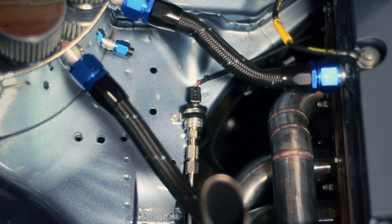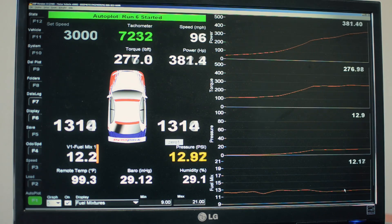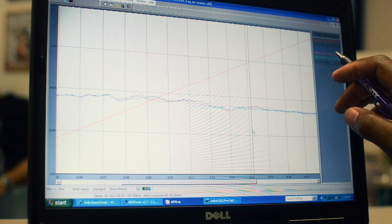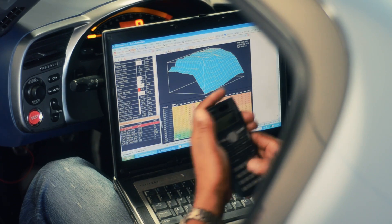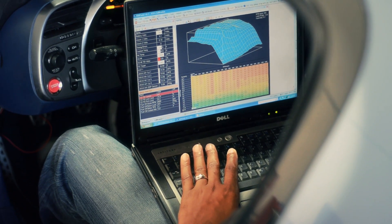The importance of the pressure compensatory circuit inside the four-channel system is extremely important. As an experiment, we disabled the system and performed a quick dyno run to see what effect this had on the air fuel ratio in each individual cylinder. As you see from the chart, we have a significantly richer air fuel ratio mixture. This is extremely important if you're building multiple engines with different exhaust housings or back pressure based upon exhaust system size.